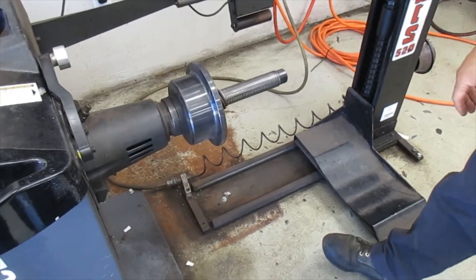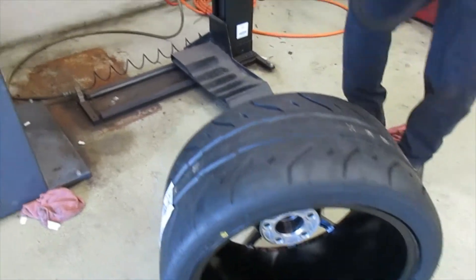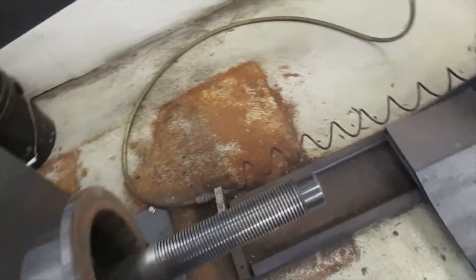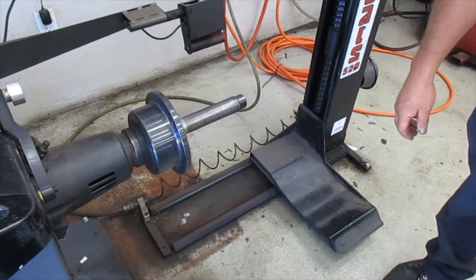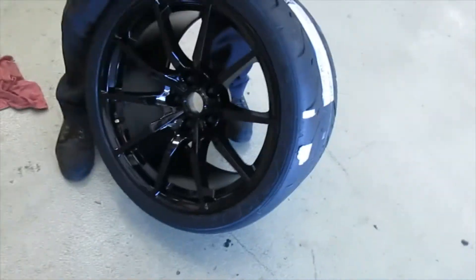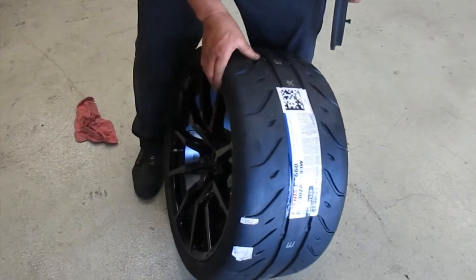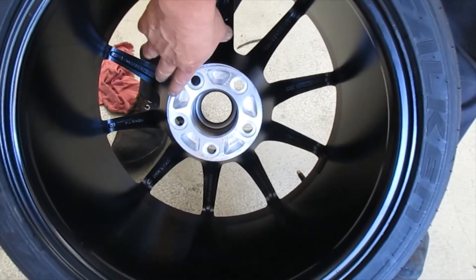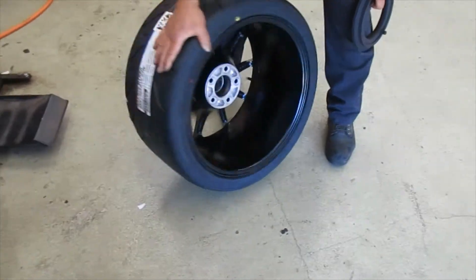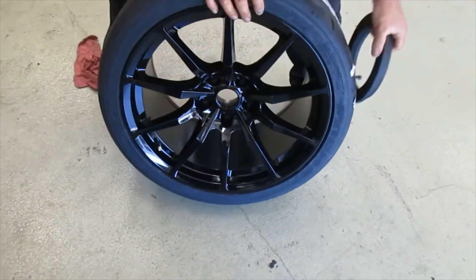For an aluminum wheel with a machined surface, you want it right up against the hub without the spring — small cone and then the wheel lock. For a steel wheel, it's the same setup. Steel wheels are straightforward: cone on the outside, because there's generally a stamped circle in the center of the wheel, and generally no difference between the two sides. Some aluminum wheels have a coating on one face, so that might not be a good surface to center the wheel off of.